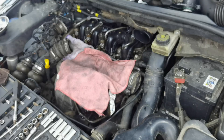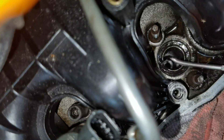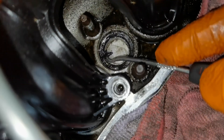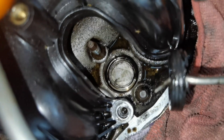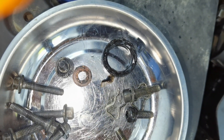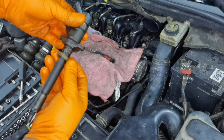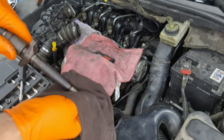Just make sure that the wire you are using is strong enough and that it goes through the washer, because if it's not going through the washer you won't be able to catch it. You'll also see the rubber o-ring which you'll have to remove. I recommend you to put a piece of paper inside the engine because you don't want anything to fall in. Use something sharp to put it under the washer and you'll be able to remove it. So you have to remove both the copper washer and the rubber washer. Then clean all around the area where the injector was installed.